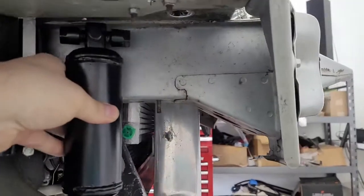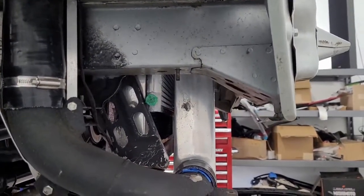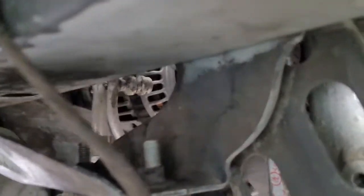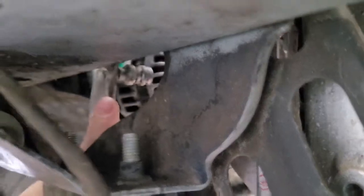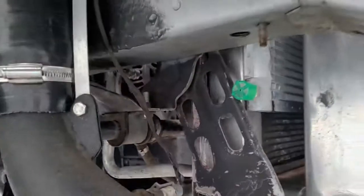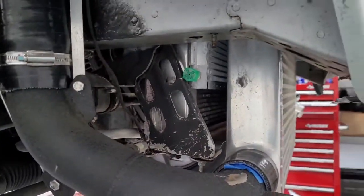I mean, you've got from here all the way to there. You can see it can move a little bit. So there's a decent amount of room here to put it, and this would be desirable for a few reasons. One, you've got your liquid line from your condenser right there, and funny enough, if you go a few more inches over back here, and I can't really point, that's the other hose that we need to hook to. That's the liquid line that goes to the front. So essentially, right in this region, that's where we want the dryer so that the hoses are as short as possible to save weight. So for example, we're not putting this on the driver's side. It's definitely going over here somewhere.